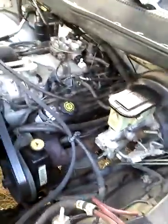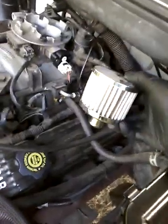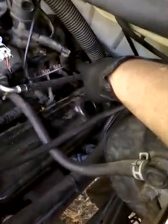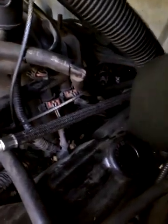The other thing they don't tell you is where the harness connector is located on this engine. You have to take the air housing off. I removed the EGR vacuum and took my breather off, which is just a filter breather on my air intake. Back there by where the distributor sits is where the harness is located. Be careful because there are a lot of wires down there and you don't want to pinch or break any.